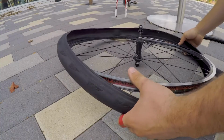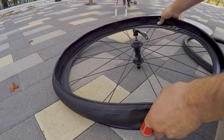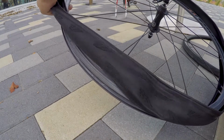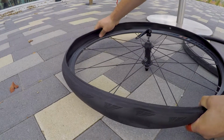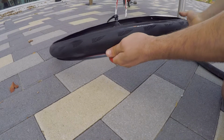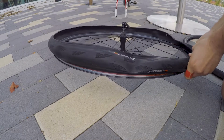Still true. Alright guys, the next step's to get the new tyre onto the rim. So basically you just want to sort of feel your way around one side of the sidewall and put it into the rim. You kind of see me doing it here now. Mostly in, it's just a bit tight on one side. It's popped around. It usually pops in pretty easily on one side. You can just see me popping it in there. That's in now.